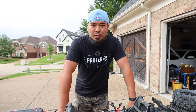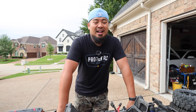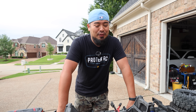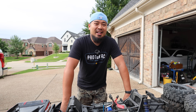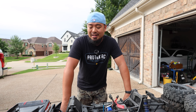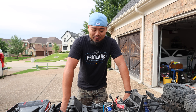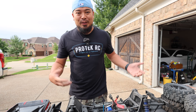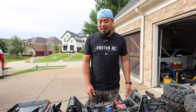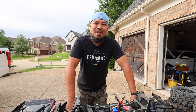All right, I'm going to test to see if the electronics work — firing it up for the first time. If you just bought an RC car and want to test the power system, I highly recommend you remove the tires first. You do not want it to run away. The worst thing that could happen is it goes flying off your pit table and into a person. This is a big vehicle, so I definitely took the wheels and tires off first.